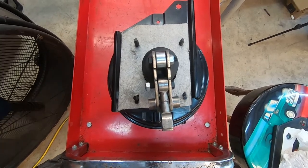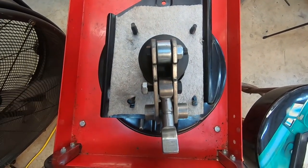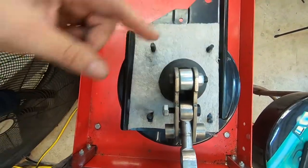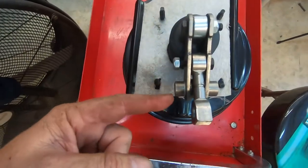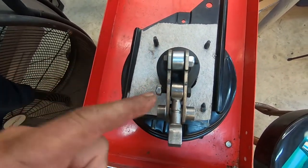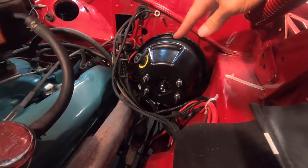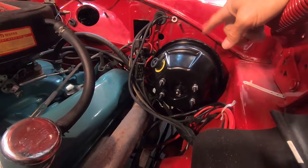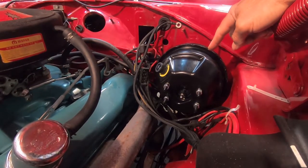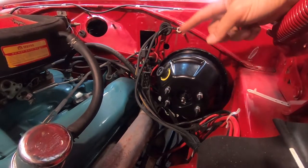One thing I want to suggest: when you go to put the booster back on, put the bell crank assembly on first. After you put that booster in, it's almost impossible to get that bolt in because the brake pedal housing comes right around it. So put the crank assembly on, pull this bolt out — that goes to your brake pedal bracket — then slip it through the hole. Trust me, you're going to thank me for that suggestion. The booster is now installed and fits up against the firewall nice. It's just a test fit, but it fits good. Now it's just to go back inside, bolt it up, hook the linkage up, and then work on the outside getting the master cylinder, lines, and proportion valve done.